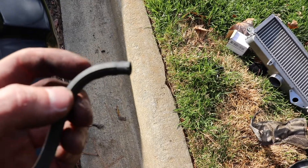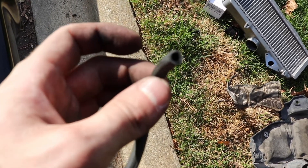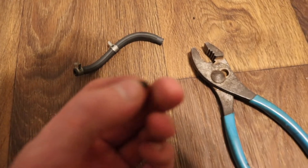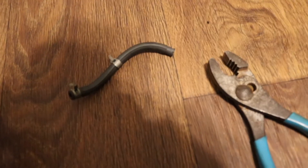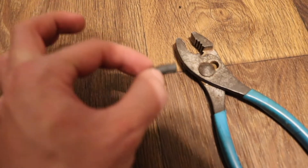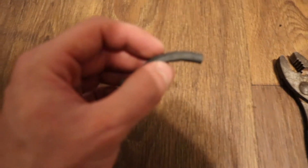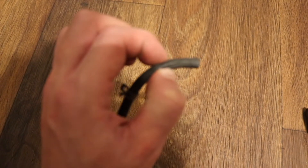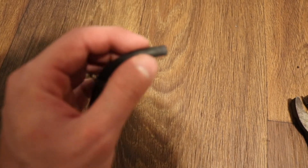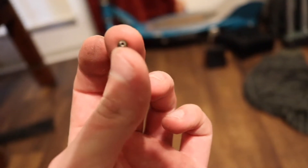I took the fitting off and you can still see a little bulge in there. If you look inside there's a little pill with a hole in the middle — I have to take that out. To get the pill out: here's the hose that had it, and mine was right up at the tip. The easiest way is to get pliers and clamp it right before the bulge, squeeze and push it forward a little, then scoot the pliers up just a tiny bit, squeeze again — it slowly pushes the pill out. It's just a little piece of brass with a hole going through it.